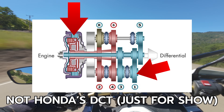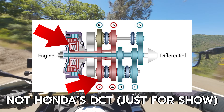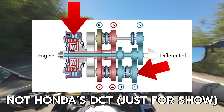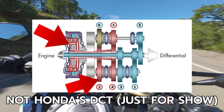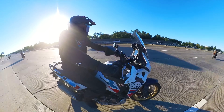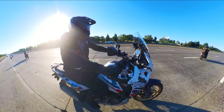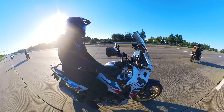The bike basically runs with two gears ready to go at any given time. The gear appropriate for the current speed is operated by one clutch, and the next gear is held in neutral by the other. When the computer decides you need to gear up, the first clutch disengages, the driving gear goes neutral, the other clutch engages, and the gear held in neutral is now spinning — providing a much quicker shift than an automatic without the power interruption of a manual.